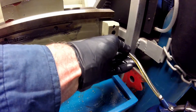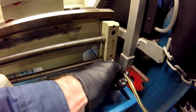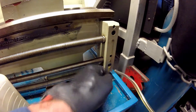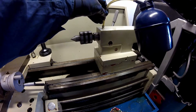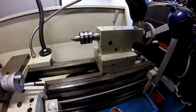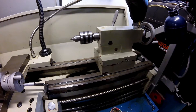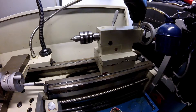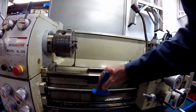From the saddle I head to the rear of the lathe bed, attending to the oil points on the end bearings for both the lead screw and the feed shaft. My final set of lubrication points are located on the tail stock. After brushing to make sure the thread of the lead screw is clear of swarf, I oil it as well.